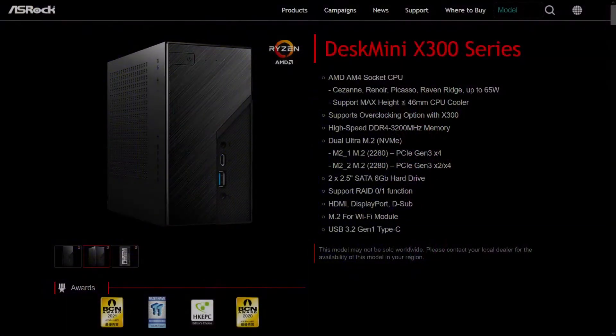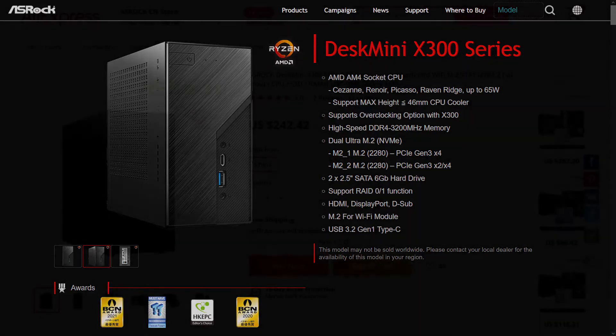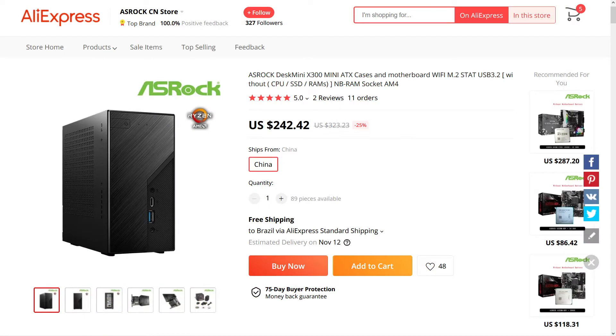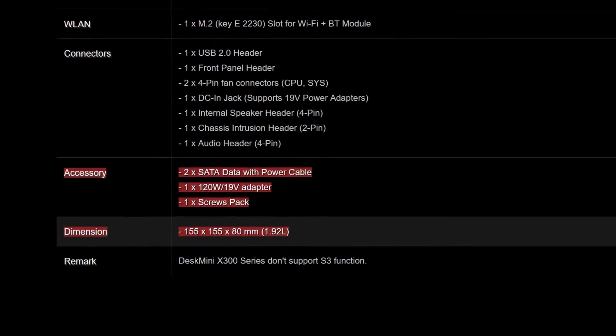Now a brief comparison with the Desk Mini X300, which is the best reference mini PC kit with some upgradability. As a third option I'm also going to simulate using a Mini ITX motherboard with a Pico power supply. In terms of price I'm considering just the core components: case, motherboard, and power supply. A Desk Mini X300 on AliExpress costs approximately 242 dollars and has a volume of only 1.92 liters — measuring 15.5×15.5×8 cm. Its power supply is rated for 120 watts, which is enough for all AMD APUs but a bit close to the lower limit.